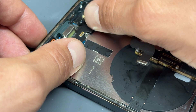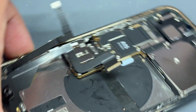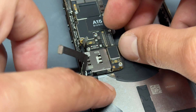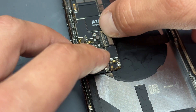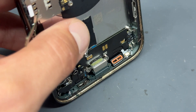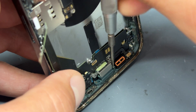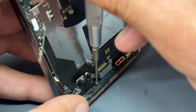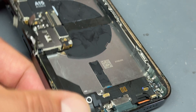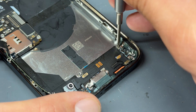Slide the flex cable under that plastic and the rest of it should follow suit. Once it's in place push it down, then for the top part fold it back on itself a bit and slide it underneath the board. Make sure it's connected before you start screwing anything back down. Alignment is very important with these charging ports — it goes into a fixed point with the two long screws either side of the lightning connector. Then it's a memory game of matching screws to where you took them out, so I go in reverse order.